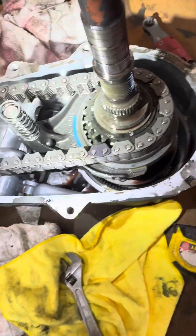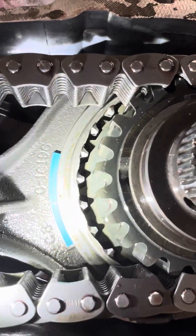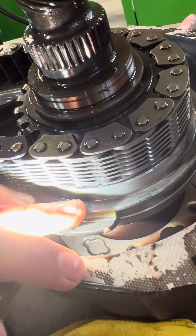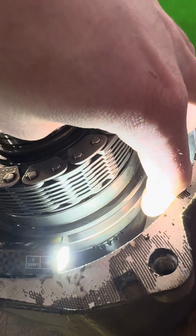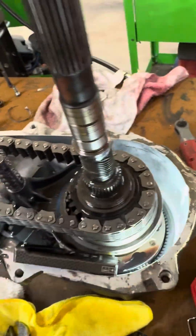Where I built mine wrong was this gear right here that sits just underneath the chain. I can't remember what that gear is called, but basically it's orientation specific. This lip right here is perfectly perpendicular to the horizontal lip that my ring finger is on right there. If you look at the other side, it's got a taper to it. You can assemble the case with it upside down and it will not shift into four-wheel drive and two-wheel drive, but it'll still go together — and that's where I messed up.